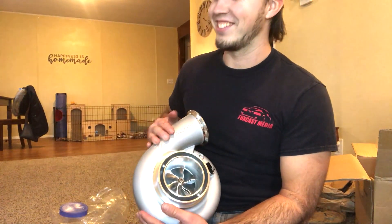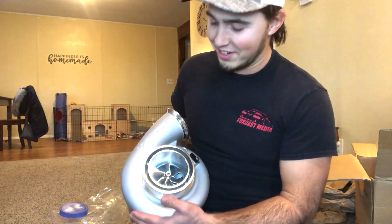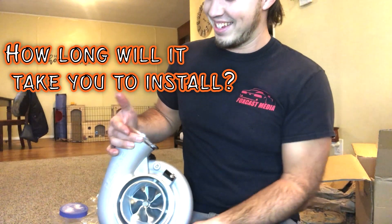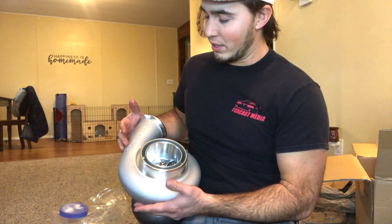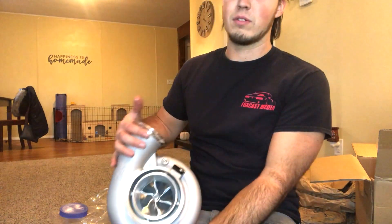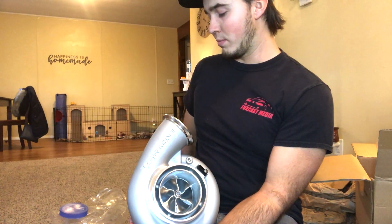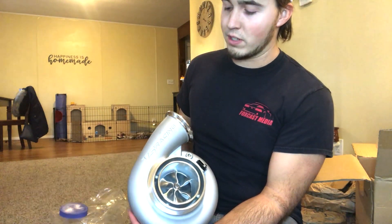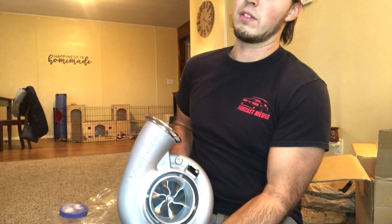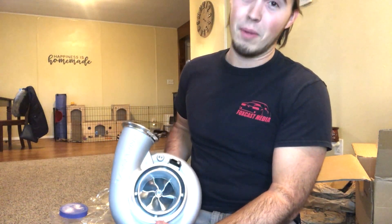So your review — you approve it? Yeah, this passes. It shouldn't be too terrible, but the hardest part is the stock shock towers are so tight on it. Getting the hot side manifolds forward — you'd either have to custom make them or run a stock-style first-gen Mustang log forward.